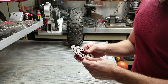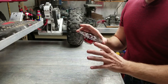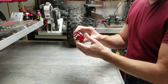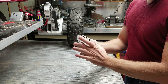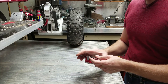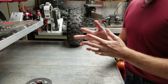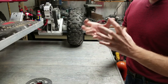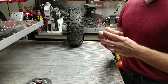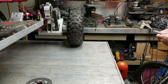Next I'll move on to making the sprocket and the hub mate together, because I'm using another go-kart wheel hub — that's what this is, a hub originally designed for a wheel — and I'm using it as a brake disc adapter and I'll be doing the same thing for the sprocket. I'm not using a standard go-kart sprocket; I'm using a custom-made bicycle-pitch sprocket. Go-kart sprockets are usually steel, thick and heavy, and larger in diameter than I need.